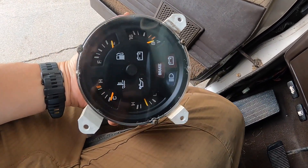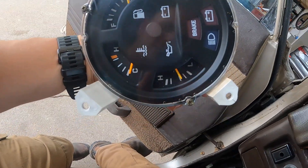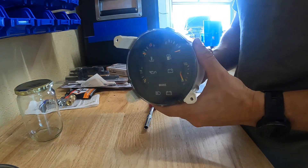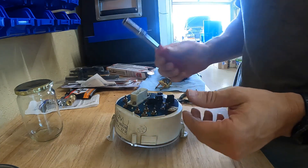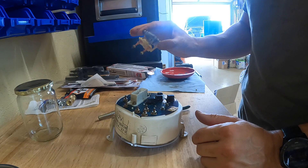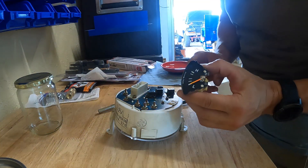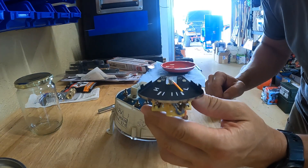Now we're going to take this to the workbench and test the gauge element. You can already see that if I turn mine like this, the needle's moving. In fact, I know this gauge element is broken. We're going to take it apart — we'll need a seven millimeter socket, and a really small pair of fine needle nose pliers. We already know the gauge is bad, so I ordered a used one from CruiserParts.net. They have a good selection of used Land Cruiser parts. Let's pull the old one out and compare.